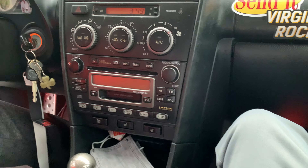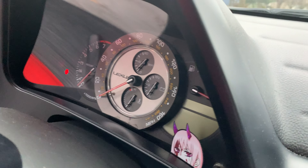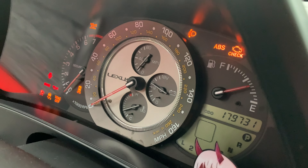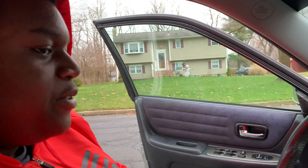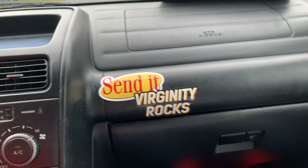So we're just getting back — just drove the car. I had a weird thing where the temp gauge would not get over like the fourth tick. That's as hot as it got and we drove it for like half an hour. Usually it gets to about halfway. It is literally freezing outside, but we might have to check the temperature sensor because she wasn't blowing any heat either.